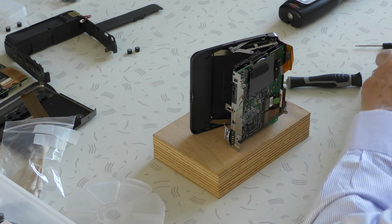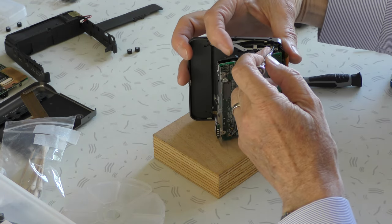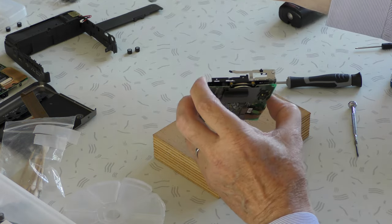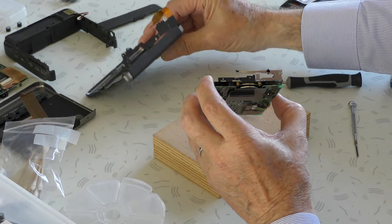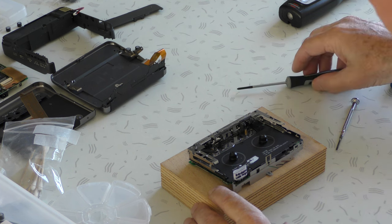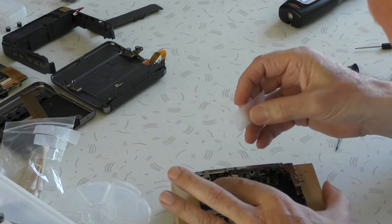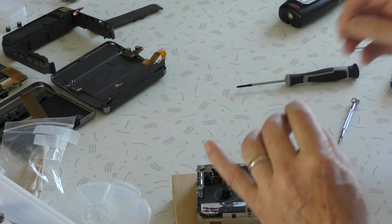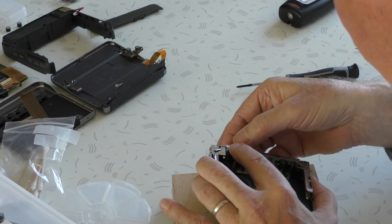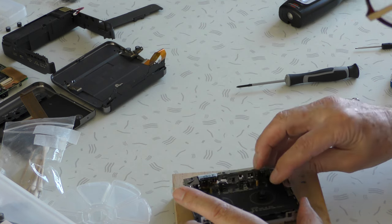So this is what you have to do. Use a small screwdriver to place it underneath this hinge, and then it's possible to remove the lid. So this is the base from the DCC player. The next thing you do is take a piece of tape, because you need it to take this spring-loaded arm and fix it, because you have to remove the screw from the hinge — it must be possible for you to reach that — because we undo those screws from the hinge to remove the head block.